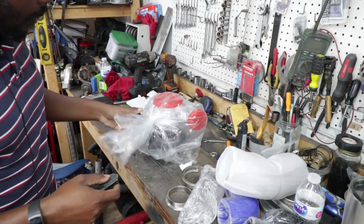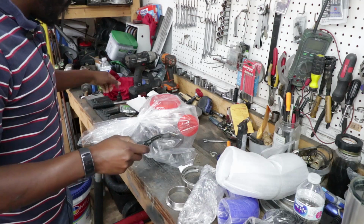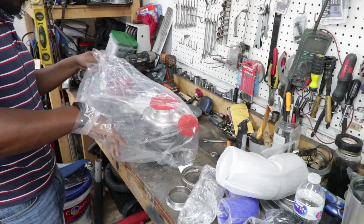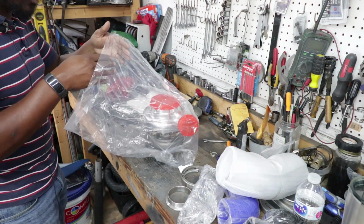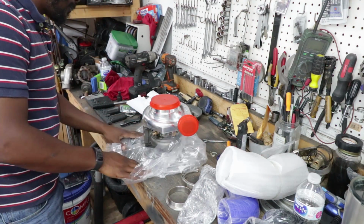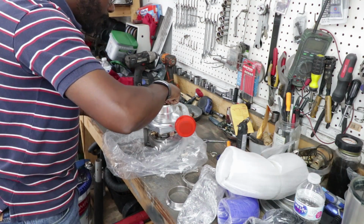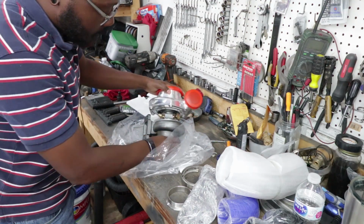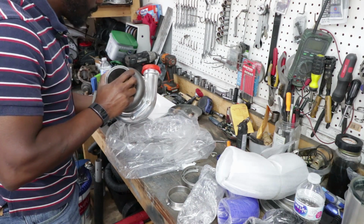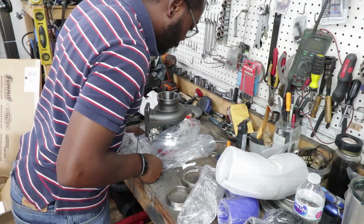So anyways, this is their new X series. This is, like I said, made in America. It's dual ball bearing. This is a GT3576R, or should I say it's a 76R clone. Jesus, this thing's big. It doesn't spin very well for a ball bearing. Oh man, it's light. So it's got a .63 exhaust housing on it. Hopefully it'll spool decently on my tiny little engine.